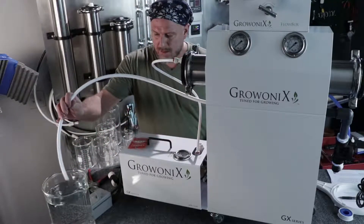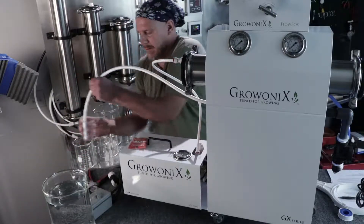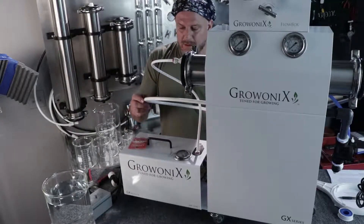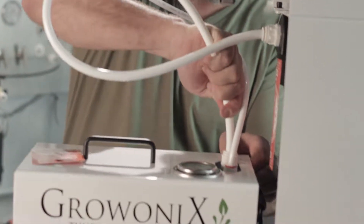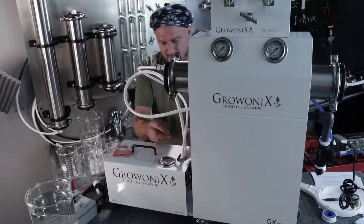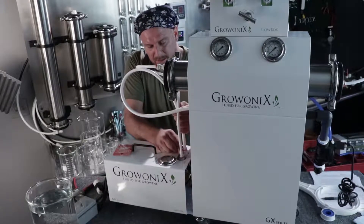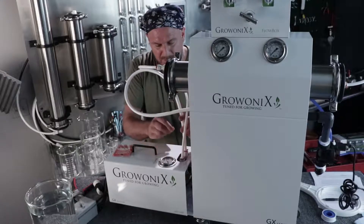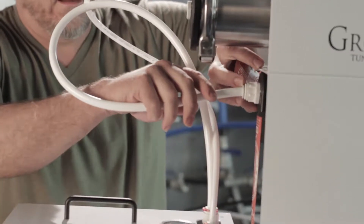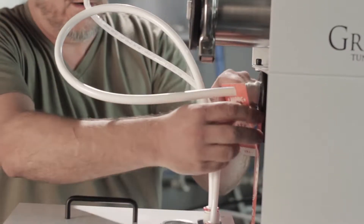So to do that, I'm just going to drain this tube really quick. We've already cut it to length, so now we're just going to insert it into the pump input. Wipe up any little water there, and I'm going to put on a high pressure clip. Although this is the low pressure side of the unit — the feed water coming in — it's not necessary, but we like to put them on anyway. Then I'm going to put the warning tag back on the carbon filter so people know that when you change the carbon filter, it needs to be flushed.